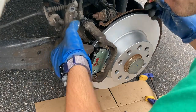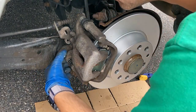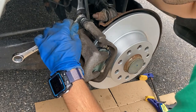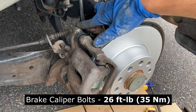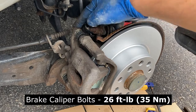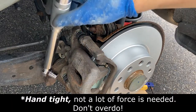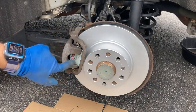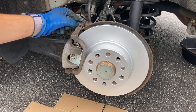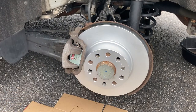I'm doing the back side as well. I'm ready to put the caliper back on — two bolts on the bottom first. The torque setting for the caliper guide pin bolts is 35 newton meters, about 26 foot-pounds. That's not a lot — you can do it by hand or try your torque wrench. I can't really get the torque wrench on the bottom here at all so this has to be done by hand. So there you have it — rotor, brake pads. I replaced the boots for the guide pins and replaced my guide pins. Cleaned up all the rust. All we gotta do is put back the wheel and torque everything to spec.